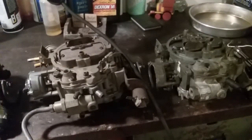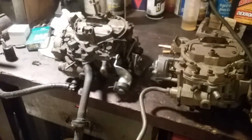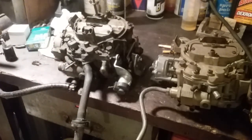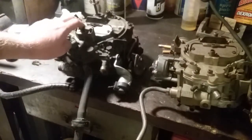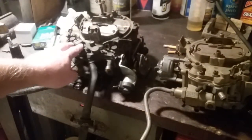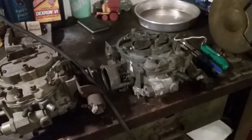Anyway, back to the basics — that's an 800, that's a 750. Over here I got one I'm not sure what it is. This came off of an '87 Monte Carlo SS I did about a year ago for my brother's friend. That's the factory carb off of it, and it's broken — it's actually got a broken ear where it fastens to the intake manifold, so this carburetor's never gonna see the road again. The choke won't even fully close. This is also a computer-controlled carburetor — it's got sensors on it. These other two are from the late '70s through the very early '80s.